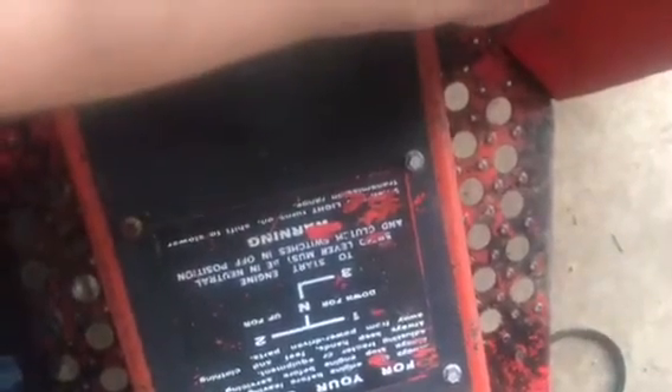The hydrostatic controls are up here - forward, and then you have to squeeze this in to go in reverse and pull it back. The coolest thing about this tractor is it's got three ranges - it's a full heavy-duty hydrostat and then it's got three ranges in the shifter: low, medium, and high. If you want to roll it around you can just throw it in neutral.